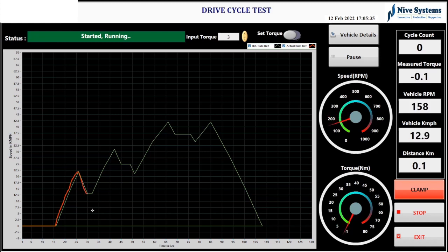In the drive cycle test, the number of cycle counts and distance covered are calculated — approximately 0.6 km per drive cycle. Initial torque is also applied to check how the vehicle withstands ups and downs including braking. The user accelerates the vehicle based on the green color line representing the simulated test condition. Data is checked through both PDF and Excel log files, showing time to reach particular speeds, maximum DC current, DC voltage of the battery, and state of charge over 60 cycles.